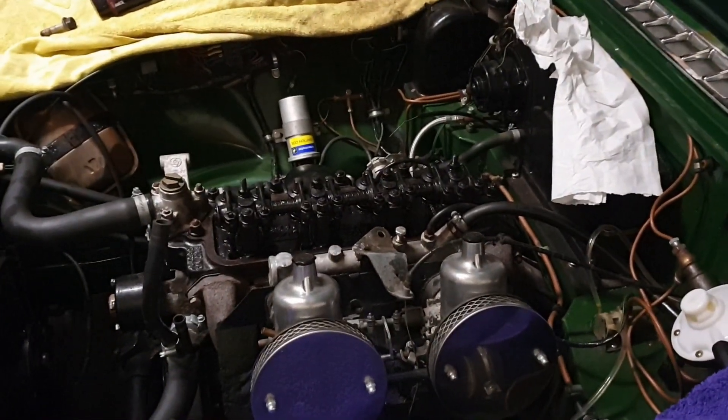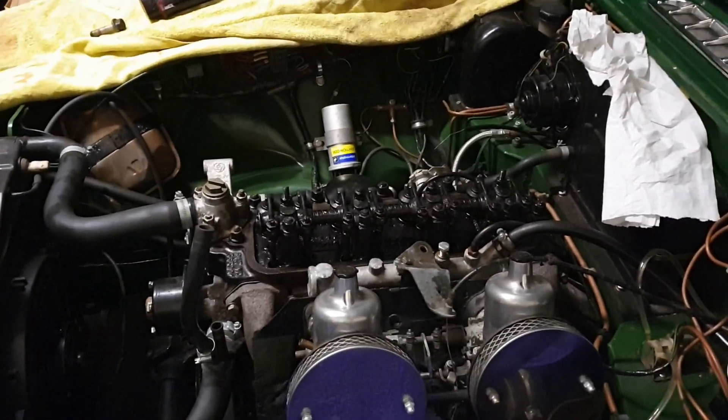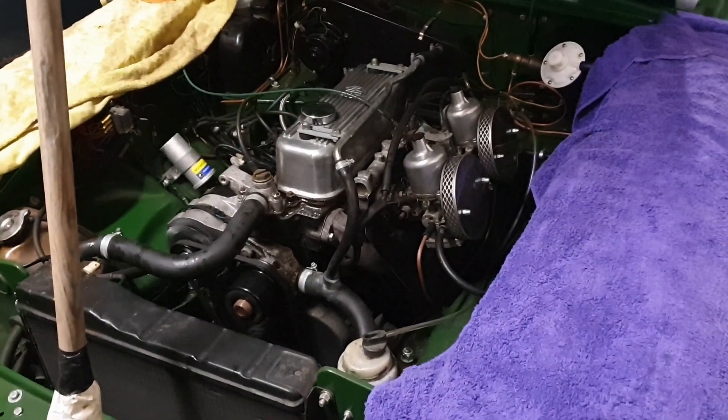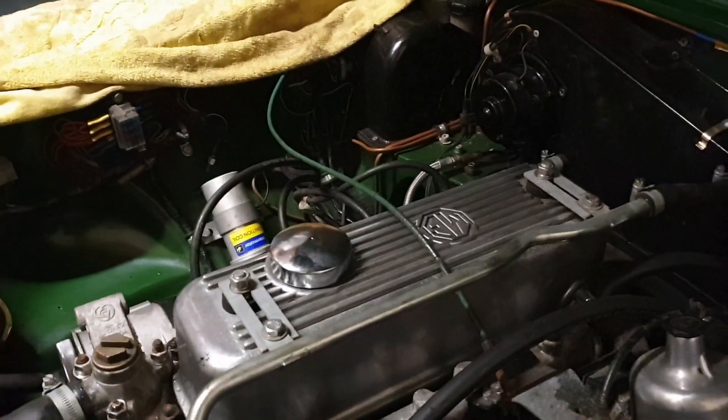Maybe now - should I have a test start perhaps? And here we have it - sorry it's a bit noisy. Four litres of antifreeze, bit of water, and it's like a very noisy watch. No steam now, runs a lot better. The thermostat hasn't fully warmed up yet, it's starting to bleed through a bit.